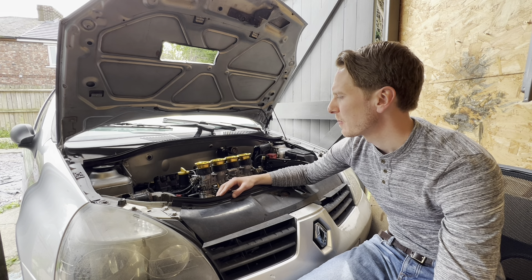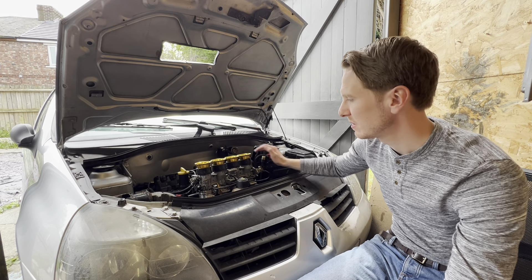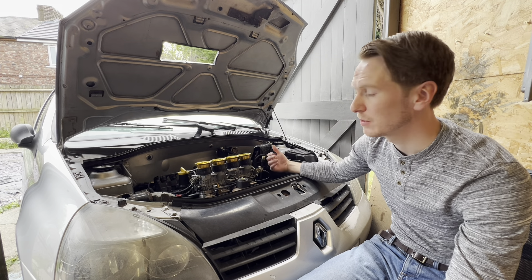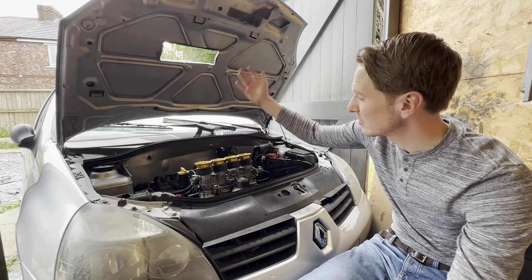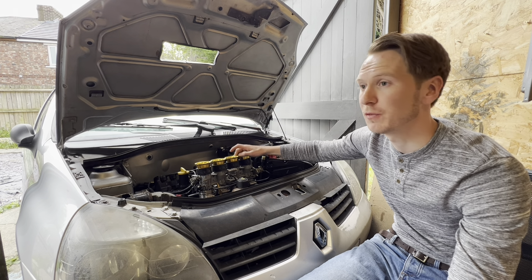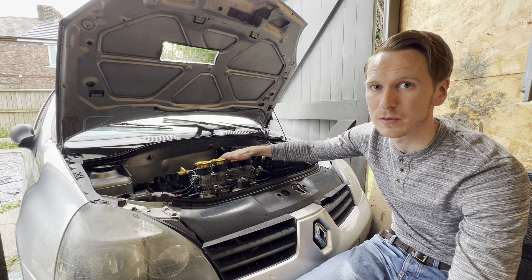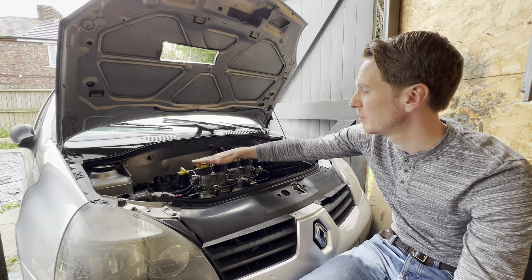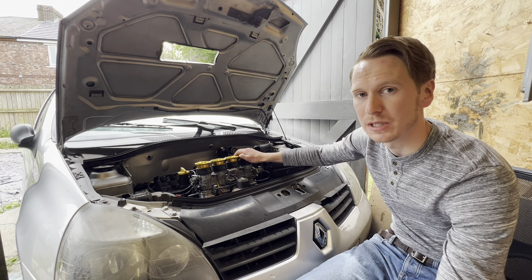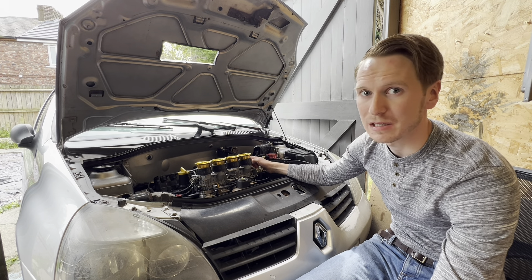Except there's nothing flying out apart from steam — water molecules. This is the same principle but on the intake. There's an individual throttle body setup with runners going into the cylinder head. If it was to get a backfire, the gas would just shoot out the top — nothing's damaged, nothing's exploded, absolutely fine. If you had a proper engine setup or a metal intake manifold, which some cars do have, you wouldn't need these. But this was me wanting the car to look pretty cool and to fully embody a combustion engine.